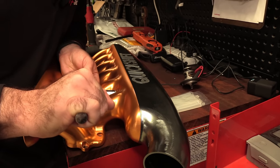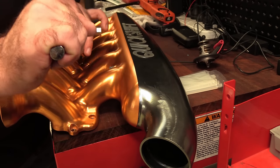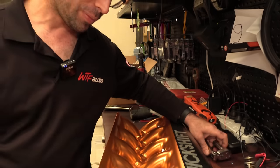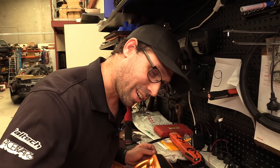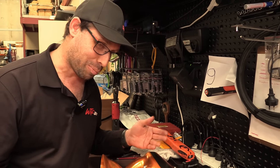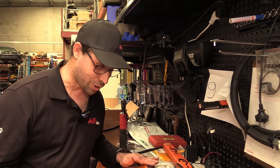It's closing up. I'm going to say it's closed up there. And around here, we've still got what I'd consider to be, that looks like 0.1 mm. That, to me, a 0.1 mm gap over that entire distance, I'm satisfied with. I'll probably remake a lot of these parts anyway, because they are prototype items. So we make them with the possibility of minor issues in mind.